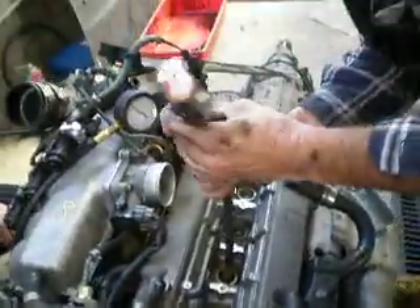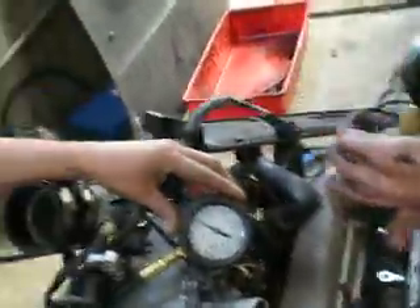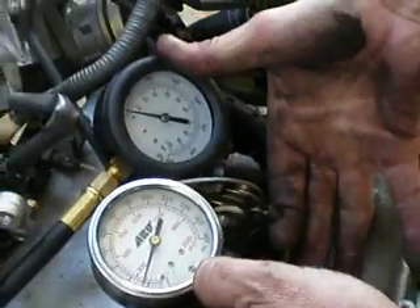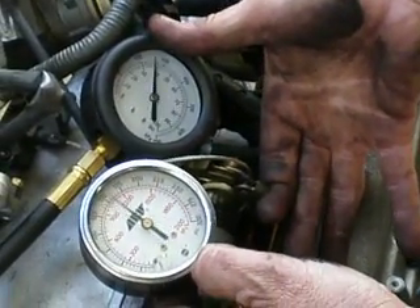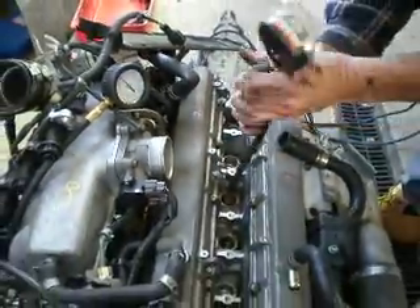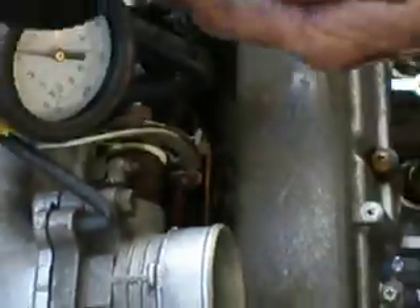We'll check the oil pressure too, it's going well is it? Yeah, oil pressure doesn't seem too bad at all. We'll just check that — oil pressure at the same time as we do the compression next time round, we're going to get both gauges in the picture. Excellent. That was 175 on number 4. I didn't check, I just showed the people on here. For number 4. Okay, thank you.